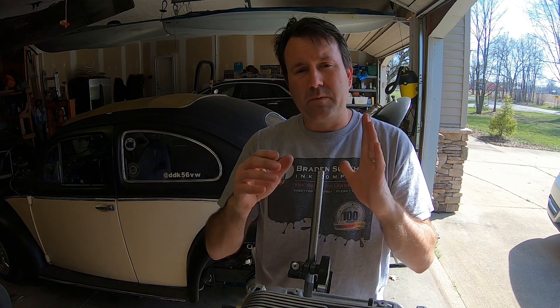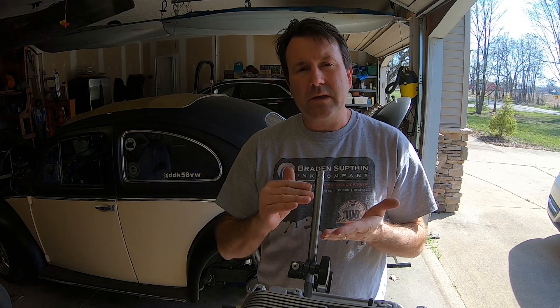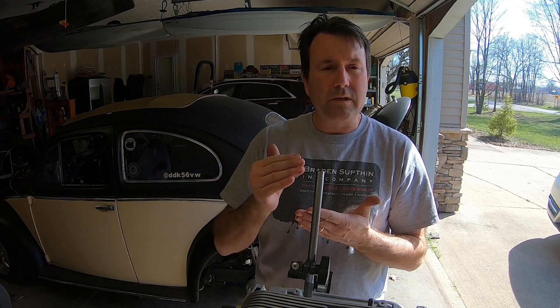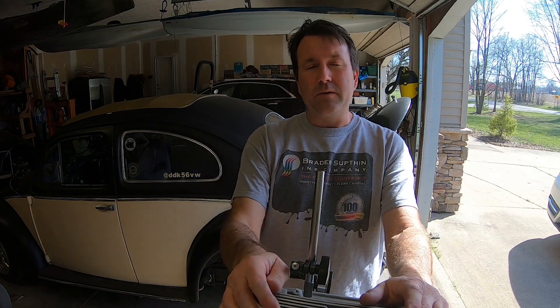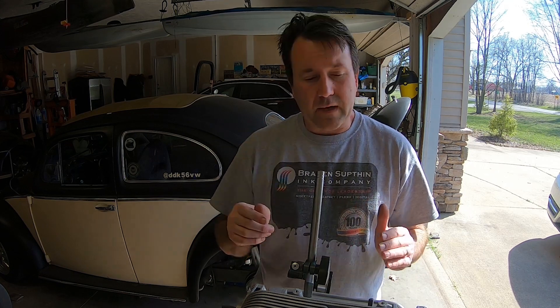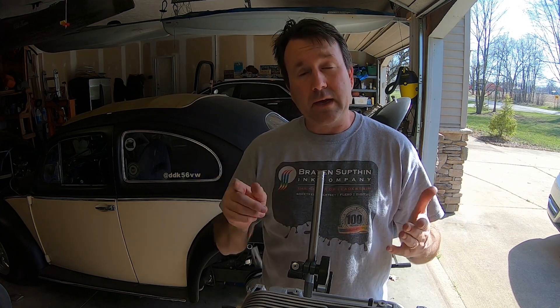The first check I did was a piston-to-valve clearance check where you basically clay up your pistons and bolt the head on, run everything through its motions, give it a good full 360-degree turn, let the valves do what they do — open and close — then you take the head back off and check the clay to see how close your pistons come to the valves. I'm good there. I actually use Silly Putty instead of clay. Before I could do that, I had to make sure the geometry was good, and the geometry was good. I don't even have to get new push rods — the push rods from the old combination are going to work in the new combination. That's a win.